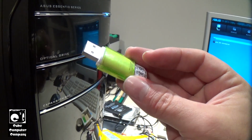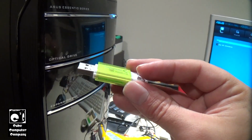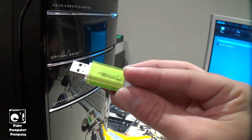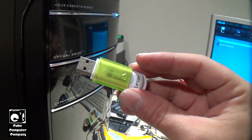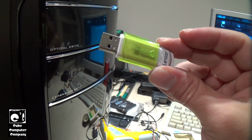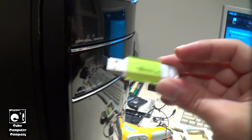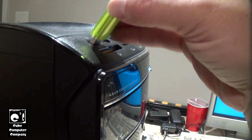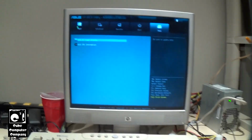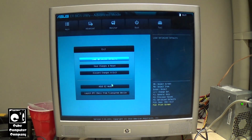So this flash drive here, what I did is I set up using Rufus, and this was with Windows 11 23H2, but what I also had done more recently was I copied over the files for 24H2, particularly the install.wim file. That way I retained the classic Windows pre-installation environment, because let's just say the pre-installation environment with Windows 11 24H2 sucks dearly. So let's go ahead and insert this flash drive, and let's go ahead and restart this machine. So currently it has nothing on it right now, so it should go right into setup.